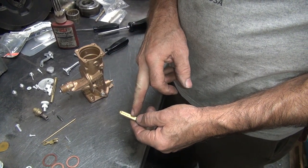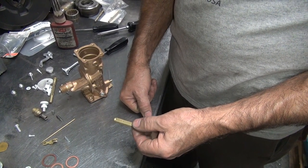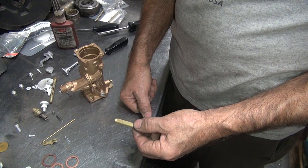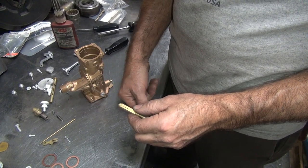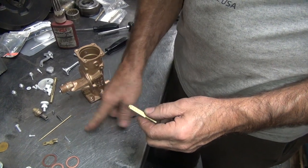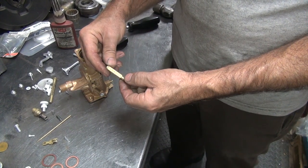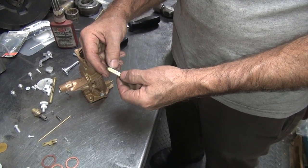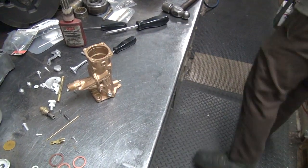What I do is put one more hole up in here — five holes instead of four — and then I see what size holes these are and go up to a little bigger size. I used to use like 59 or 60 for big hot rod motors, then I started going down to 52 because modern gasoline is a lot leaner — it's more like kerosene, it doesn't want as much. If you're using racing gas you want bigger holes, but with this crappy gas we have these days, you want less. So I'll put down like 40 or 52 depending on what you want. Your muffler is stock still? Yes — okay, so we'll probably run a little bit leaner. I'm going to guesstimate.